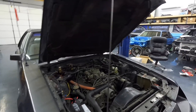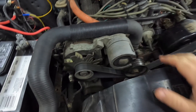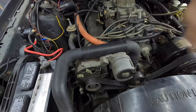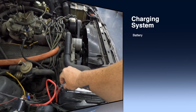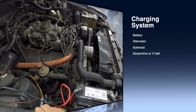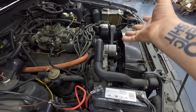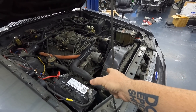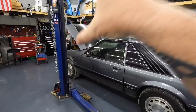A few other things to note before you drive: if your car still has a smog pump and it's hooked up, there's a good chance it's going to be frozen — definitely check for that. Check all your battery connections. Also check your starter solenoid, as those can go bad from lack of use. Your alternator can die while the car is sitting too, so check your charging system. In summary: you're going to need a new battery, probably a starter solenoid, and possibly an alternator — add those to your list.